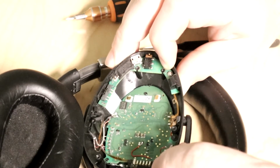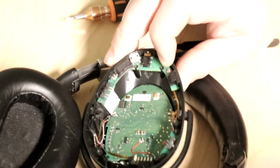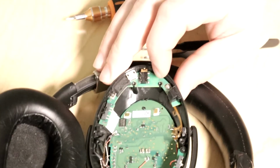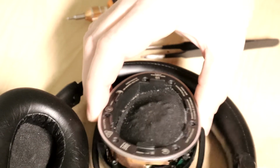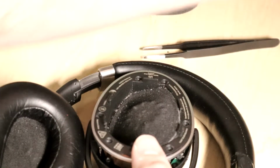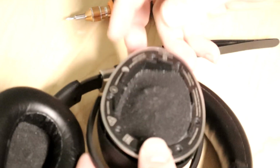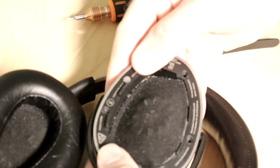Okay, I just heard it say power on. Power off. Okay, so my switch is now currently working. Let's try to push this back together and see. I don't actually want to snap it all the way back together and screw it in yet. I just want to make sure it works. But with the other headset having a slightly different possible fault, I might need to do some voltage comparisons around. So I want to have it accessible and ready.